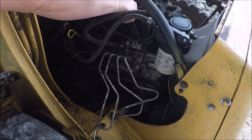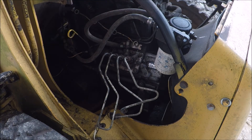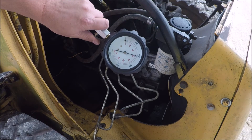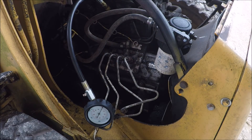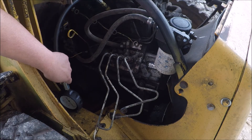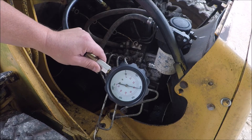I'm taking out this other cylinder's injector and putting this adapter in the next cylinder. Tighten it nice and snug, push on the pressure adapter, and got to remember to release the pressure out of the valve — back to zero. Let's run that and see what we get. You hear that popping noise? That's the other cylinder because I don't have the injector in it. Again, we're getting about the same reading — just a little bit over 400. Should be a good cylinder, shouldn't have any issues going on.